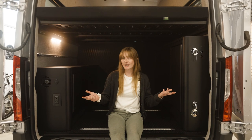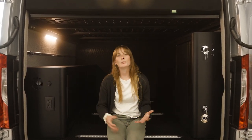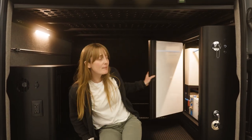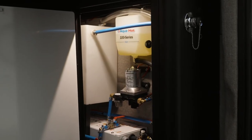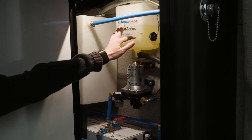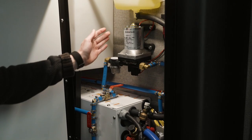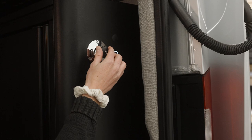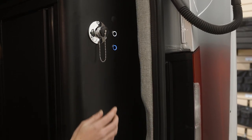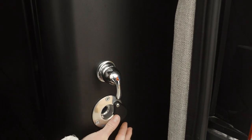In the garage area, behind our interior bulkhead, we are going to find both of our utility cabinets. On my left side, we're going to find our water cabinet. Inside, we'll see our 28-gallon freshwater tank and our AquaHot heating system. On the outside of the cabinet, we have our hose fill — this is where we would plug in a hose when we want water in. When we want water out, we would plug in our hose down here and use our mixer for hot or cold water.